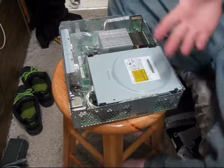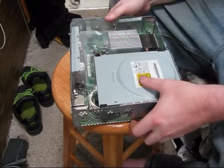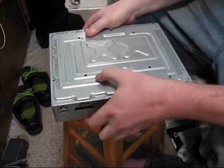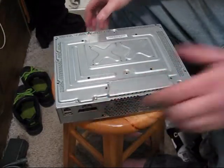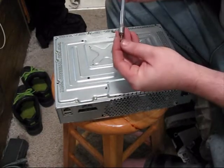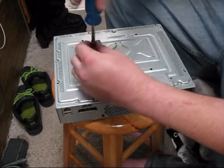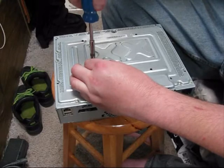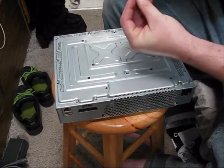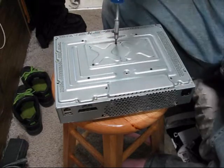What I forgot to do is screw in the CPU and the GPU — it's a normal mistake and I can do that right now. I've got screwdriver kits. You do want to screw them in because they will probably move if you don't. Not likely, but it just assures that the heat sinks won't move at all.